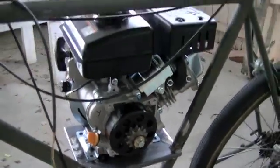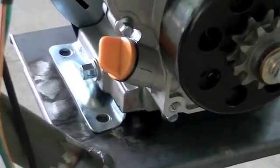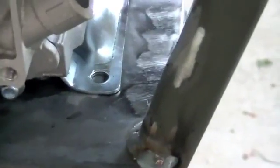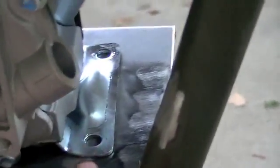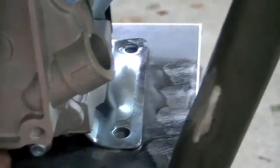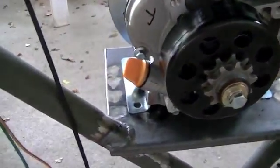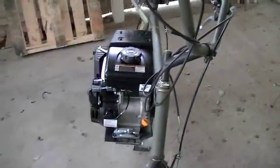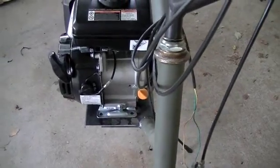I got the engine sitting on the little engine plate, and I'll make one little point here. Zoom in a little bit — as you can see down there on the bottom, I put that little adapter plate back on. I was doing some research and found it's actually kind of important to use that. The engine casing is just cast aluminum, which is fairly soft, so this engine plate actually absorbs some vibration and shock, and it helps prevent the engine casing from cracking. Because if that cracks, you've got to go buy a new engine. So I put that adapter plate back on. And since this engine is so offset to the right side of the bike, it fits — it didn't fit when I first tried it, but it fits now so I'm going to use it.